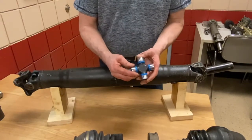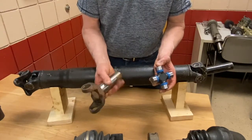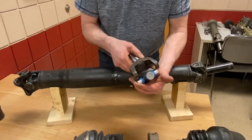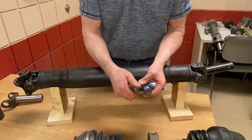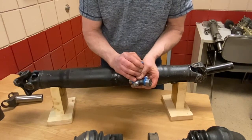If we look at a typical universal joint, I'll pull it out of the yoke assemblies. Here I have a slip yoke — this one goes into the transmission and has splines on the end. This sits in the transmission and the U-joint fits into the yoke. Universal joints, sometimes called hook joints or Cardan joints, look like this inside. There's a special machined surface called the trunnion.